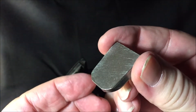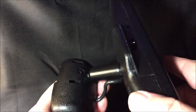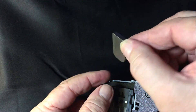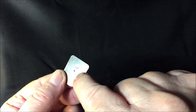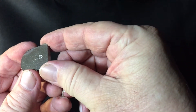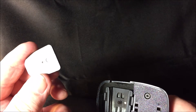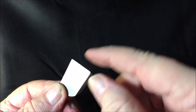This mount goes on the windshield first — let it set up, say 30 minutes after it's been glued, though I would give it a day. You don't glue it with the mirror base on it. The only thing you're actually gluing to the windshield is this piece right here. This is the little detent divot hole you'll use for alignment once it sets up on the windshield. So this flat side is the only thing I'm going to be gluing, after I clean it up.